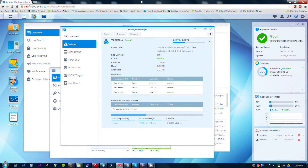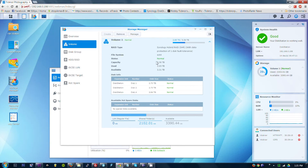And we're back. That expansion process — the expanding of the drive, adding a 4TB drive to my existing RAID — took 40 hours. 4-0. So almost two entire days. But during those 40 hours, when my volume was in expanding mode and processing, all of my data was still available. My network shares were still up and running, and I could read my data off of those drives. I'd never tried adding data to the volume, but in theory that should have worked. It may take a very long time to expand a volume, but all of your data is not held hostage during the process — it's all available to you, which is really cool.